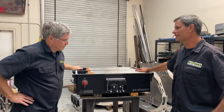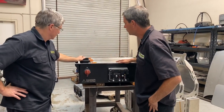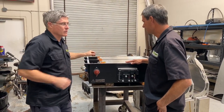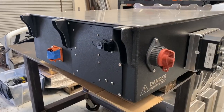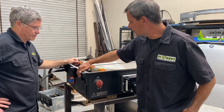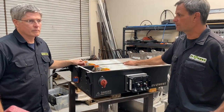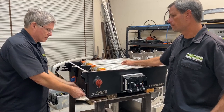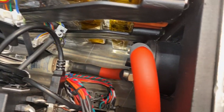Here is our battery enclosure, inverter bracket, safety cutoff, BMS, and high-voltage fuse. There's a data link over here and six Tesla modules. It's completely self-contained — everything in one package. My favorite feature is the access panel on the side, because we do have serviceable items inside: the high-voltage fuses and the BMS. Even though there's a bulkhead connector for USB and communication, you still have the side plate accessible so it can come off. You can service the high-voltage fuse without removing the box — just remove the retaining bolts and the whole side comes right off, giving easy access to both BMS modules and all of the relays inside.